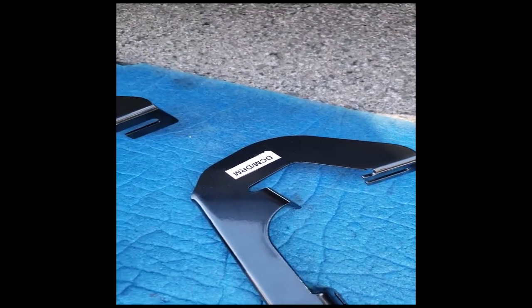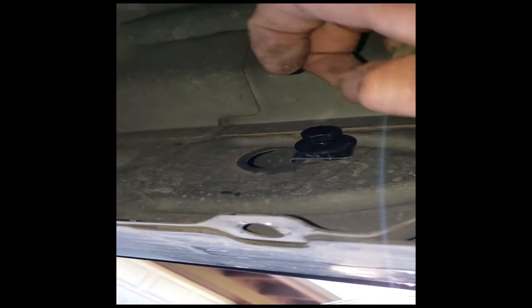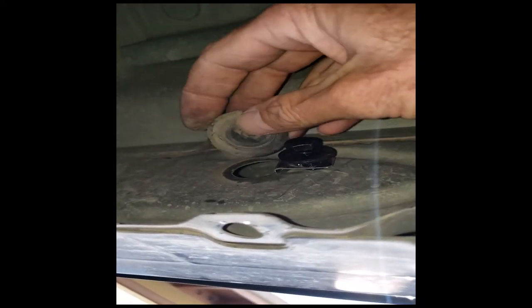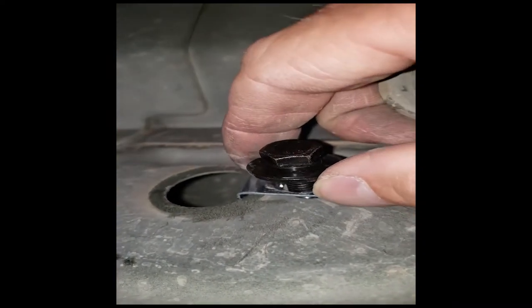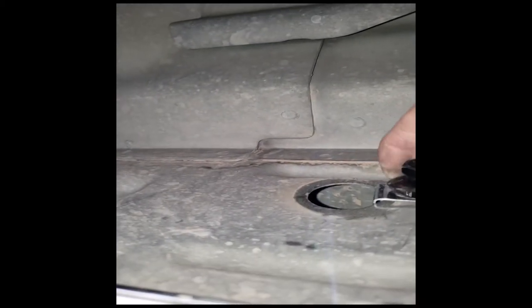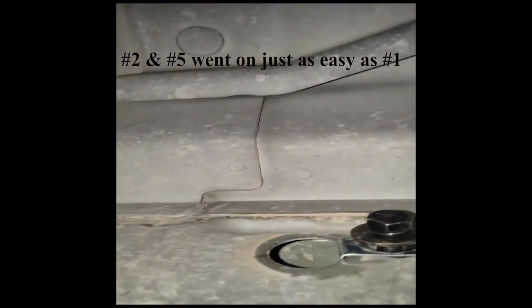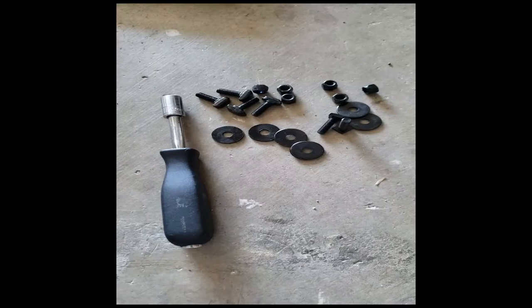For this last one, this little tab was a bit bent so I had to bend it back down. This cap was over this big port here — to take the cap off, it just pops right out. Then slide the fastener into the big hole. There's another little hole next to the big hole that this bolt will go through and join into the fastener. I kind of preset it up here and slide this mount over the top of it.